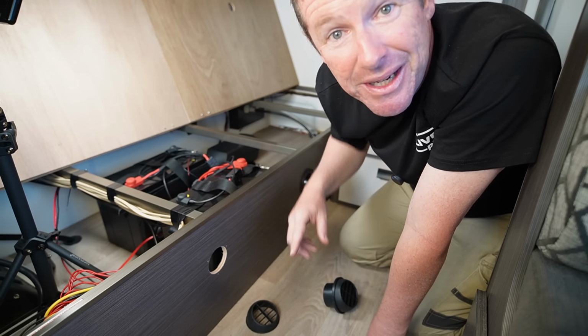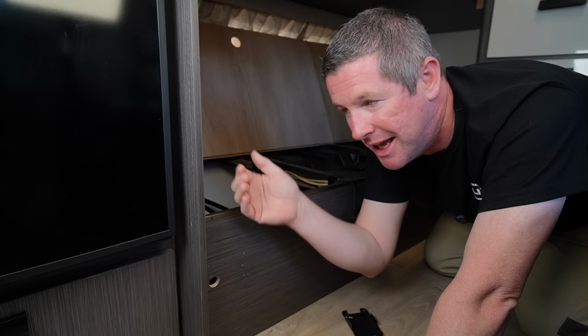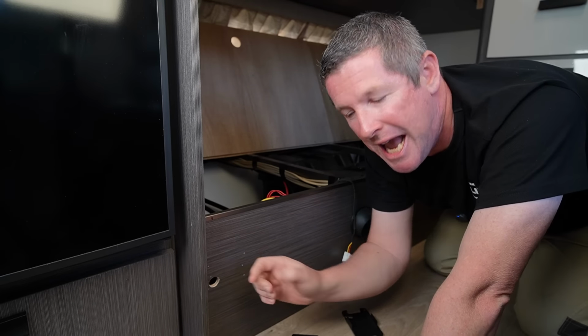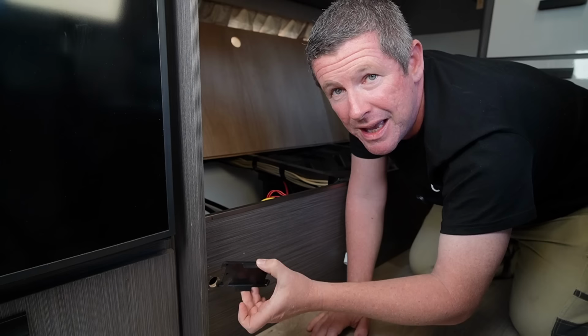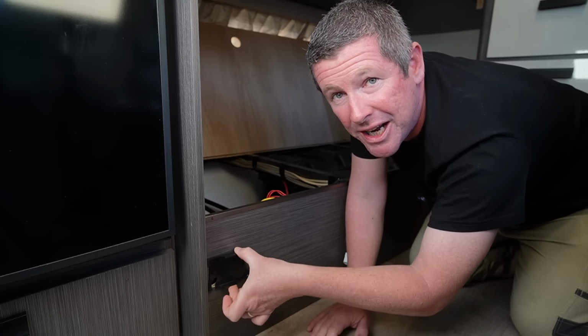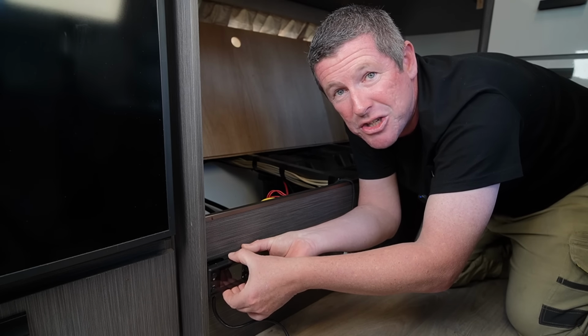Get the duct all connected up to it, then we'll mount the control panel. So this is the opposite end of the bunk area, and then obviously you can see our fridge here. We've got a little fixed panel that comes out, which is really good because I can actually mount the control panel down here, and it's protected a little bit by this panel protruding out. Now what I've done is I've just made a 20mm hole on the side, and that is large enough for the plug to fit through so we can connect it up to the rest of our harness. And it's in a location that works with this little cutout that I've made on the mounting plate. So how it will work in our instance is I need to run the cord through to connect the plug up, then this will slide in over the top, and then we can actually mount our control panel into place without too many dramas at all.